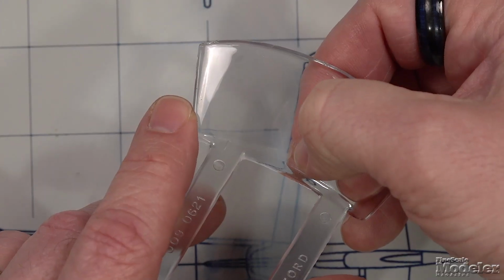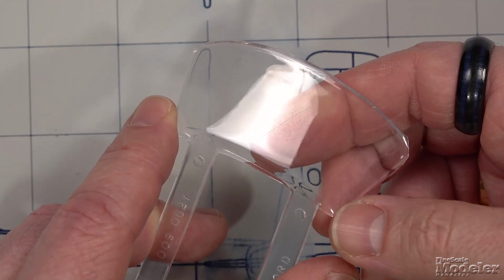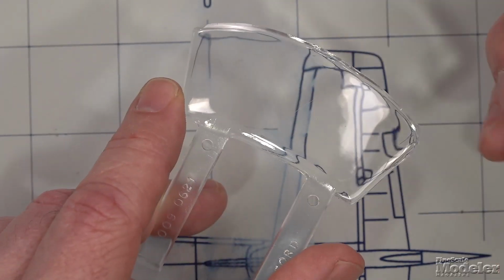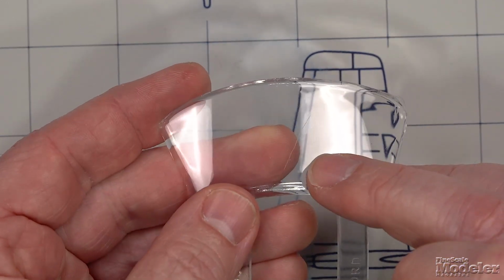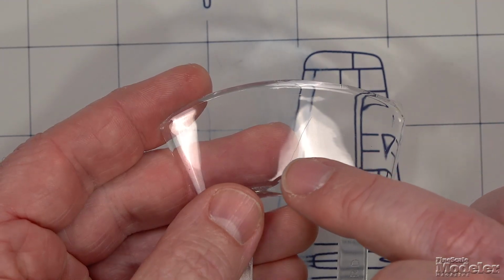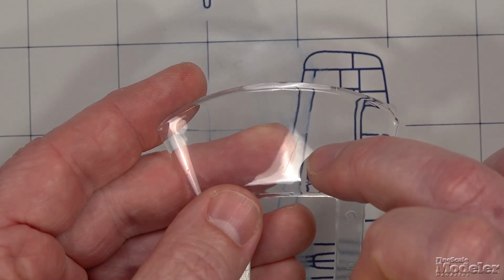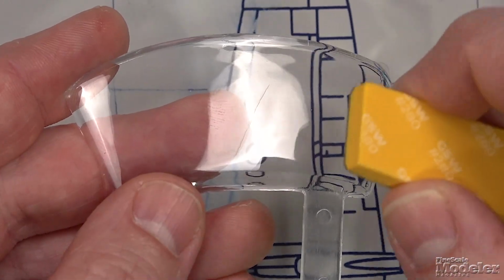And me just rubbing my fingernail across that, it's not super deep. That scratch is not really terrible. So I don't think that I need to go in there with the coarsest grit, but what I'm going to do is start with 280 grit. And again, you don't want to cause yourself more work than you need to, so try and just focus on where that scratch is with this initial sanding, because this area is going to grow as we go through all of these grits.